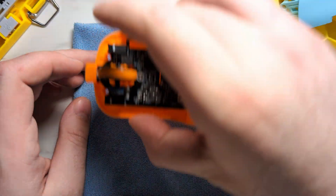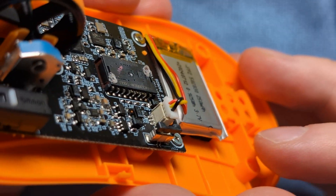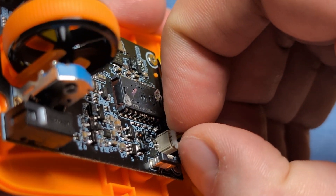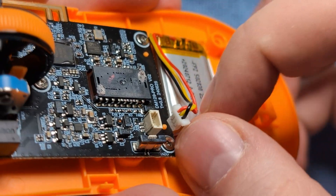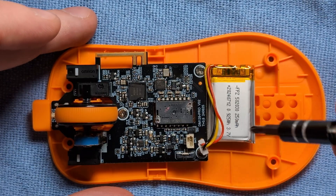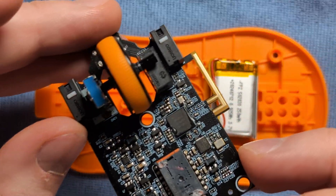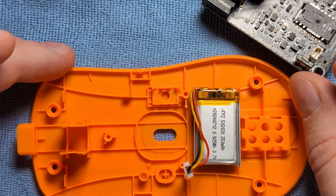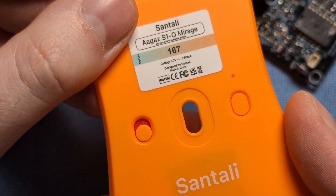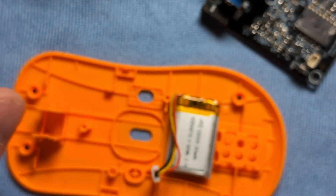Let's talk about the base shell next. This assembly is actually quite easy as well. First, we're going to disconnect the battery — just take two of your fingers on the side of this connector and wiggle up, and that will disconnect the battery. Then we can remove the three anchoring screws for the main board — there's one here, here, and here. Once that's done, gently pull up from the side of the board and that will pull the board out of the base. There is also a slider button on the bottom that corresponds to the on/off switch — this will most likely come off during disassembly.